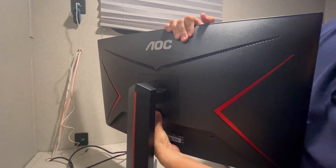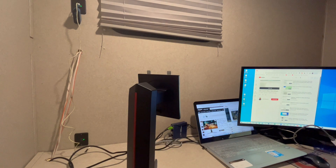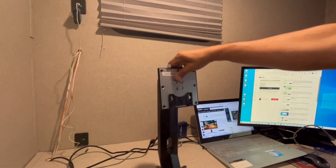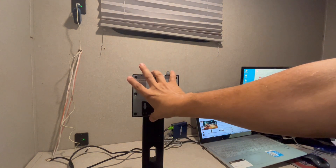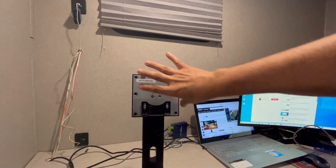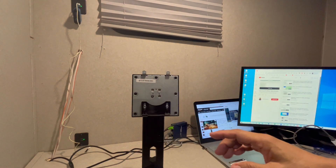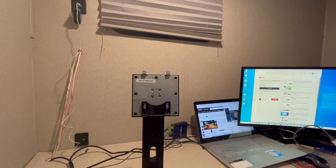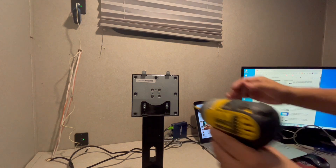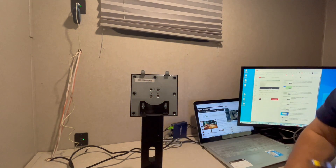I'm gonna lift up on that little button there and now I'm able to lift this thing. I'm gonna put the stand aside so I can show you what we're gonna do. The next thing is I'm gonna take these four screws out, get this mechanism and flip it. It really doesn't matter if we flip it this way or this way, because if you have the right drivers we'll be able to tell the monitor which way to go. You can use a regular Phillips screwdriver.